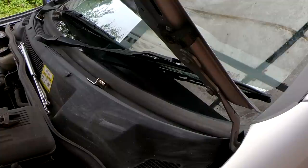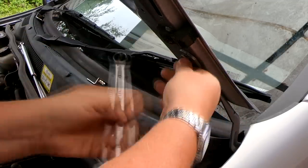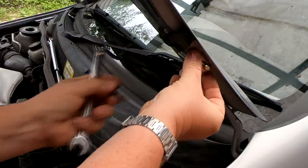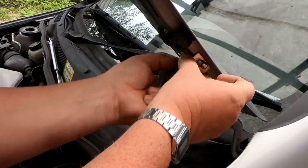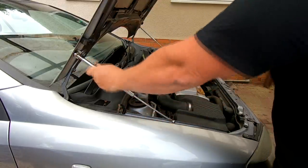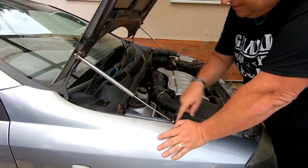So we've got these two 13mm bolts that hold the bonnet on. Let's just crack the top one and wind that out. All I'm going to do here is place this bracket under that bolt - there's our bracket there, and I'm just going to put that on this way up to keep the ball high up under the bracket itself. Then just nip that back up again. Now there's our gas strut here - job's a good'un. It was a lot easier. That bottom one didn't want to go in, maybe because of the angle being more acute. So I had to take that one off again and put this one on first - that seemed to work well.